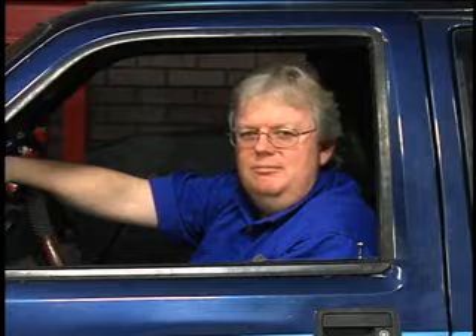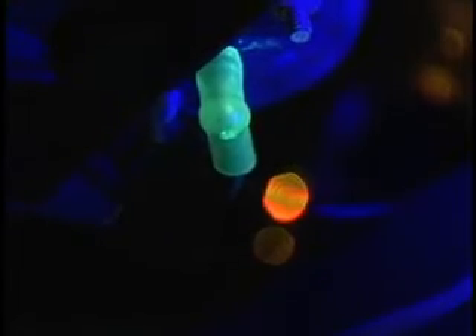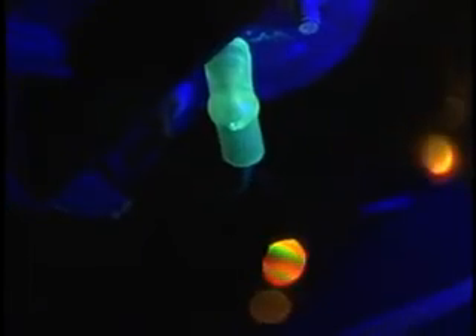Take a look with this bright light — you can see the smoke. Looks like we've got a split in on the tip of this vacuum hose fitting. Now we're looking at the Ultratrace UV dye — you can really see it there. We know how to fix a piece of vacuum hose that's got a split in it: we'll simply chop it off and put a piece of eighth-inch rubber hose on it. It'll seal good.